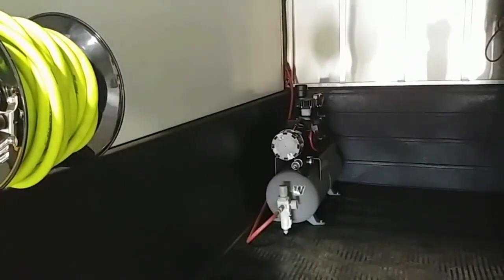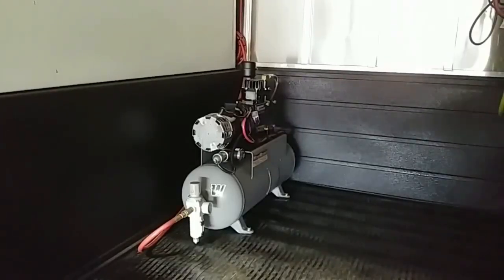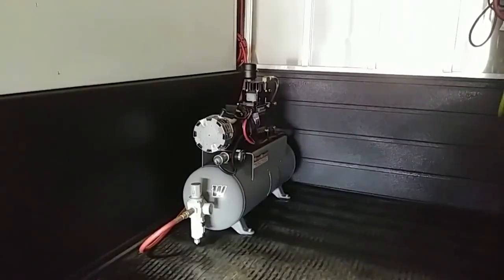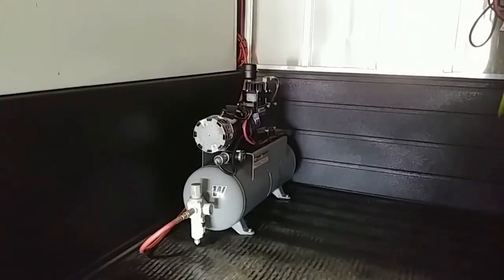It's a hose reel — well, actually more than that. It's an uber cool Oasis compressor. This particular compressor manufactured by Oasis has a factory installed tank and pressure switch. It's got a hell of a honking motor on it. It's got four gauge power ground that they recommend going no further than about six feet to an auxiliary battery if possible and a maximum of ten feet with the included four gauge. So of course we cut that down and went very short — probably about five feet between that compressor and the battery — and with that big third battery linked up front with the number one wire to the front two batteries, this compressor is running very smooth, very nice. That nice powerful feed gives the compressor a real happy life.